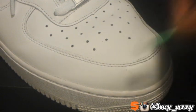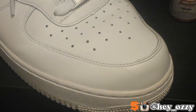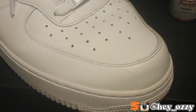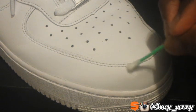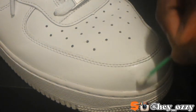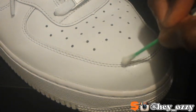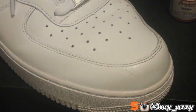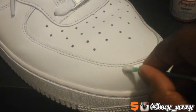If the scuff is deeper you might have to do another coat. As you can see, I've blended it in but I'm going to need one more coat — it's already fading away. So I'm going to wait about 30 seconds and get another dab of paint and rub it again. Not too much, so that way it doesn't look off, and make sure you blend it so that way it doesn't show.